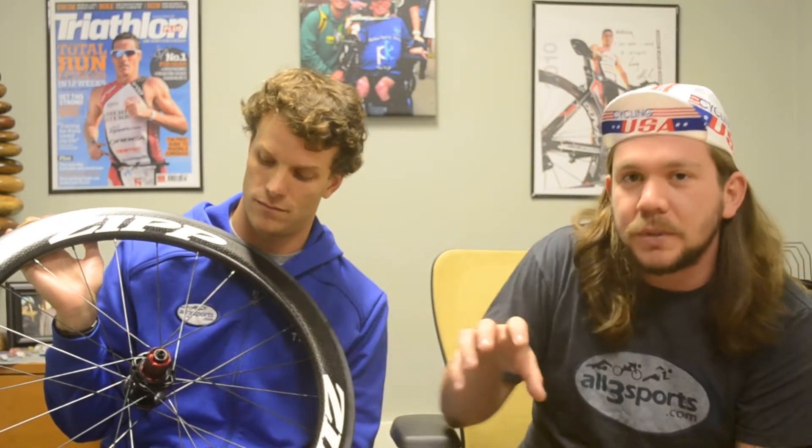I have here probably the most recognizable wheel from the Kona Bike Count — it's the Zipp 404 2014, with only slight changes from 2013. The flange on the hub is a little bit longer, by about two millimeters. It's got the dimpled rim, a roughed-out brake track for better braking, as well as a canted braking surface to match the profile of their Zipp Tangente tires. All of these wheels are 11-speed compatible as well as 10-speed — you just need the right spacer for your cassette.